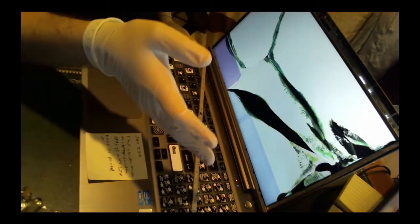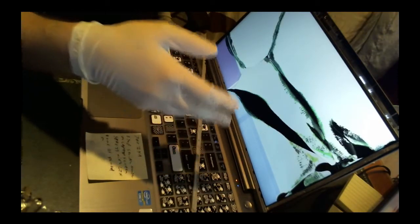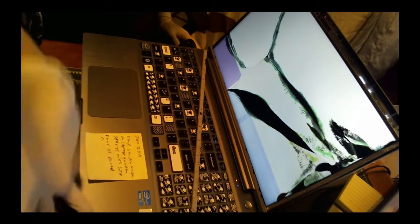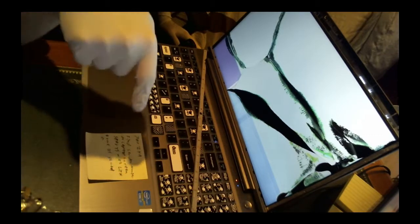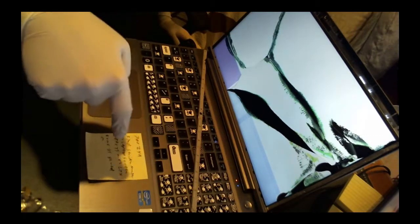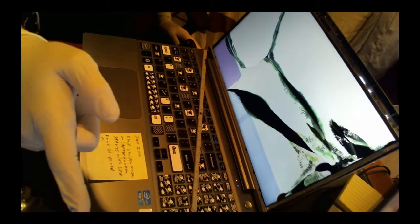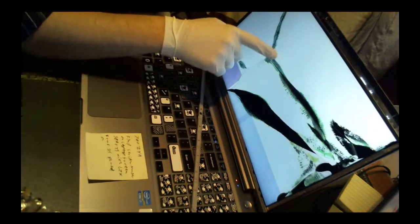And when I called up Samsung to have them convert the serial number that I got from the BIOS command, they couldn't resolve it into the model number that was on the sticker that was taken off. So what I did instead was I decided, okay, we'll go through with the systeminfo command, which should have the model number, or at least close enough to it that I can order the new screen.